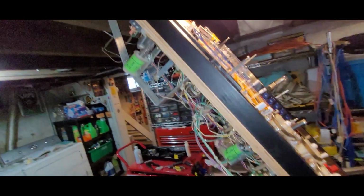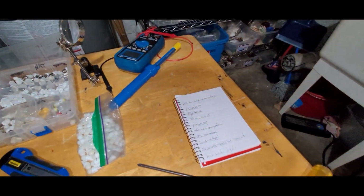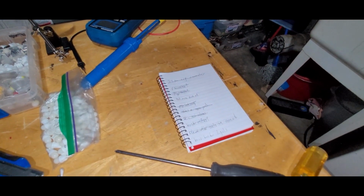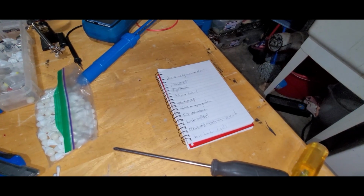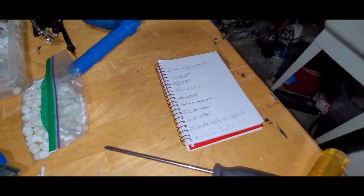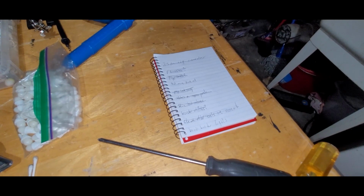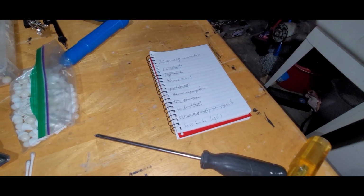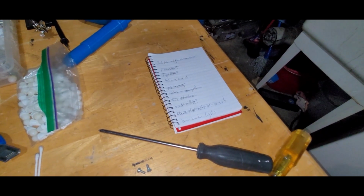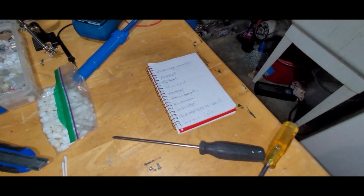What else have I done? Let's check my list here. Let's see. Oh, I want to test the mine kick out, make sure it's kicking out where it should. Middle of the right flipper. Pop LED rings. Oh yeah, I was gonna look. I had a couple pop bumper LED rings, but they're red, so they wouldn't work. Rubbers on the apron post. Blue inlane LEDs. Boulder Cliffies. Check other coils are correct. Oh yeah, the other coils are correct, like in the other mechs under the playfield. And I might want to add boulder lights for the back big boulders.